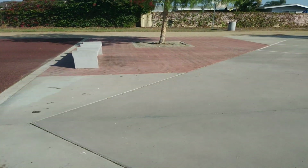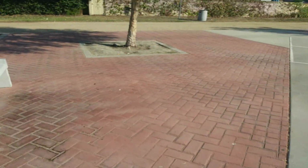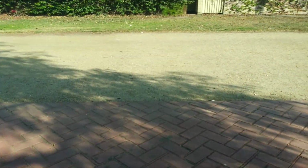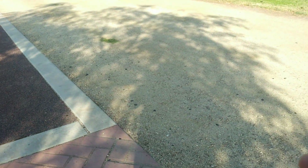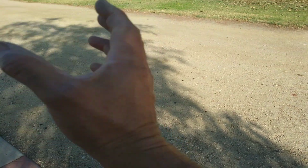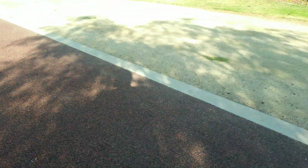This gravel over here, I run in this stuff. It's cool to do some speed runs, come flying down here, but when the power band kicks in, because it's real loose, it's hard to stay straight, man. Anything that I run down here, stock, modded, I mean, look at this stuff. It just gets loose, and this is where you don't want a vented clutch bell. You've heard the argument about what's better, vented clutch bell, does it run cooler. All I know is when you have vented clutch bells, you're more likely to get little rocks like this lodged in there. And a lot of times I'll get them lodged in the center diff and the center spur, and when that stuff gets disrupted, it'll stall out and you'll think you've got a flame out, but it's just something getting caught in there.